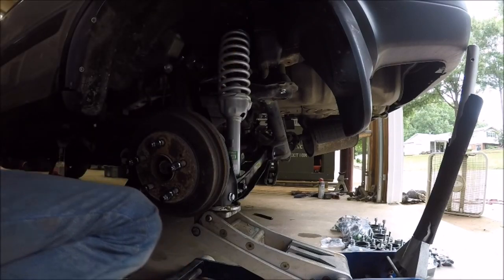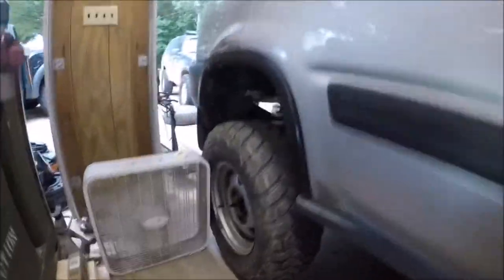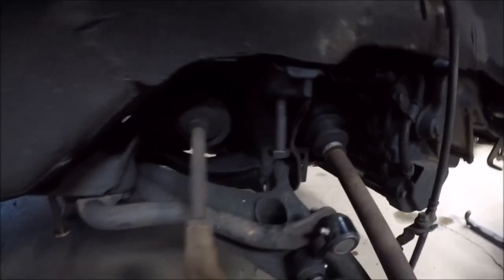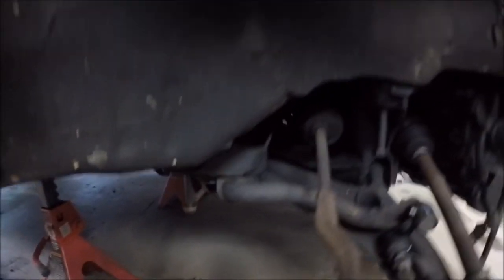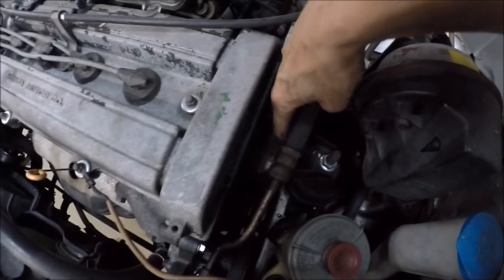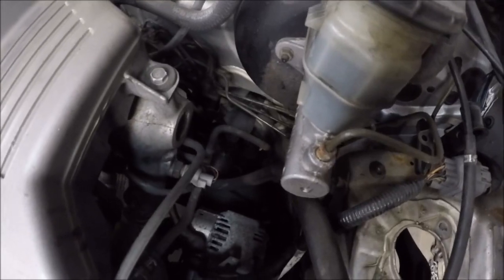You put your camber arm back in and that's it for this side. I've got the rear lift all on, tires are on, sitting on the ground — it's got an absolute ton of clearance. Now we're going to focus on getting the front dropped. To begin, I'm taking all the bolts, breaking them loose and replacing each bolt one by one with the longer bolt, so when it all drops down it'll stay in line and you can slide the spacer in one by one. You also need to get these two studs taken out — the stud and the bolt, and all the studs on this side — so you can replace them with the longer studs. Then we'll be removing the steering shaft and replacing it with the longer one.